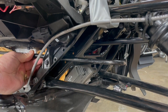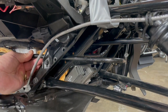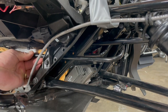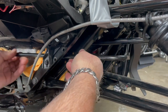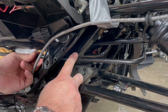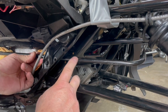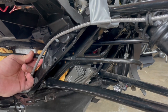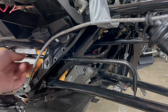Once you've done that and replicated the same operation on the other side of the sway bar — which should take about another 15 to 20 minutes — the sway bar can be moved around pretty easily. You'll see right here where the lateral stops are. They're pretty cheesy. Also notice how thin that sway bar is there — it really does not do any good service to the integrity of this sway bar. It makes it really weak right there. Now that you've got the bushing out, let's go ahead and prep to cut this sway bar.